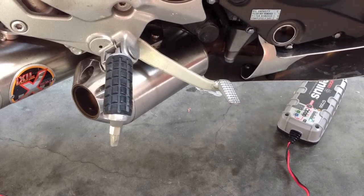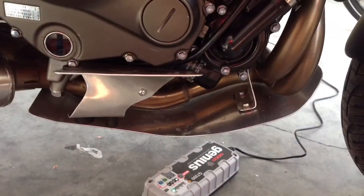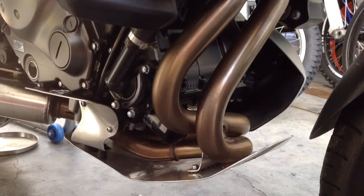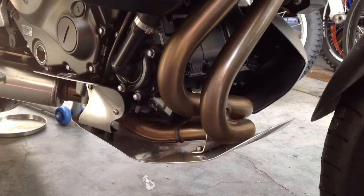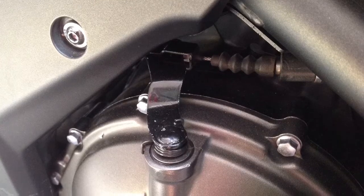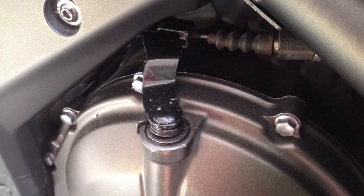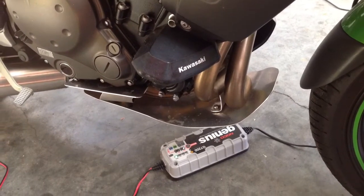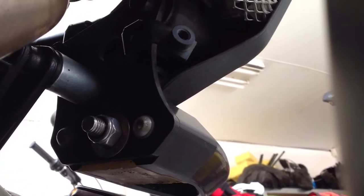Being a little tall, I had to lower and change my brake lever so my foot just goes across when I brake. When I first got the bike I was doing a lot of dirt roads and throwing rocks up, so I made a belly pan out of aluminium, bent and shaped it - it took a long time to stop it vibrating. It's been on there 8 years and hasn't hurt it at all. I got a clutch actuator arm out of an ER6N and extended it about 15-20mm which makes the clutch much lighter. The Kawasaki frame sliders I bought, I filled with araldite and put a big bolt through - now that thing's holding on there for good.